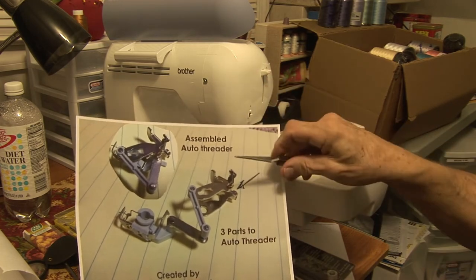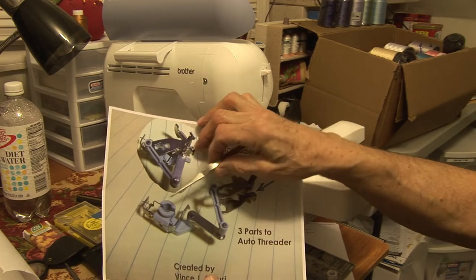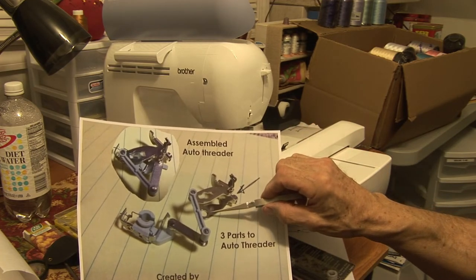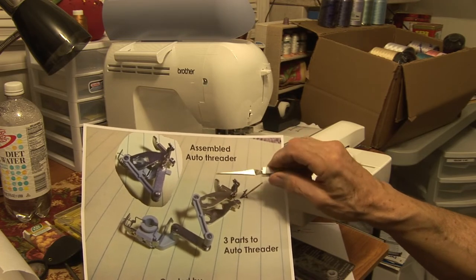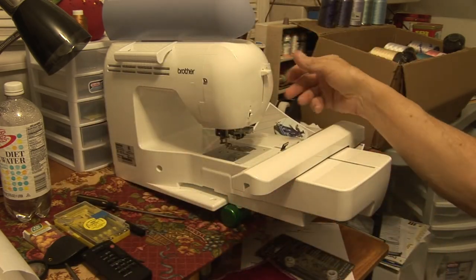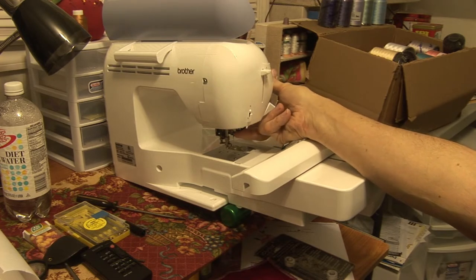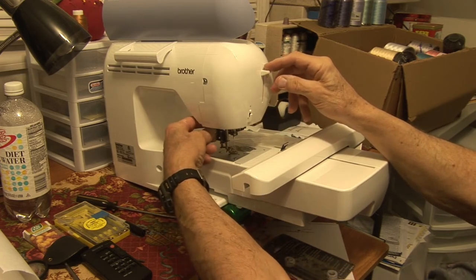And the first one I had that fell off, I found out how it went by laying it out and putting it together, because I had three little parts. It's just a press fit. This hole is a press fit on the shaft. So what I do, and you could do it when you start using the machine, you just put your finger under the mechanism and just push up a little bit. Just push up right there. Because when this works, it snaps.